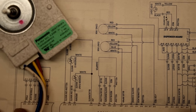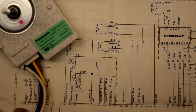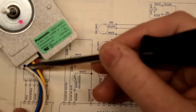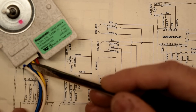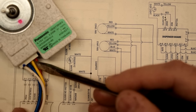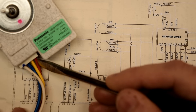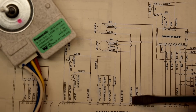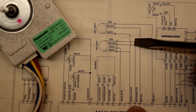I wanted to give you a quick explanation on what the four wires do on one of these motors — they're fairly complex, but we're going to focus in. This is an evaporator motor, probably looks similar to yours. You have a white which is common, blue which is the tachometer — it basically sends an RPM signal back to the control board. The yellow wire is a signal wire — think of it as telling the fan how fast to run. And then red is going to be our supply voltage, typically 12 to 14 volts. Looking at the evaporator fan circuit, the yellow and black wire that we were looking at on the control board actually changes colors to yellow at this plug.